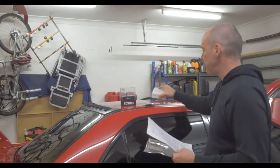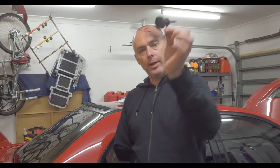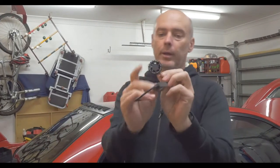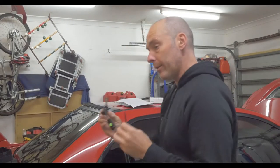The headlights are another interesting thing. I haven't actually ever had an LED headlight in my car — I've used the standard H1 halogens that come with the car, and then I swapped those out a while back to a set of Philips HID globes — the globe and the separate ballast. Pretty good setup. These are a lot simpler. That's the complete module — they run a little heat sink with a little fan in the back, a ballast, and just basically two plugs. I've installed one of these in one of the headlights.